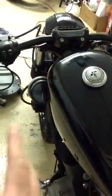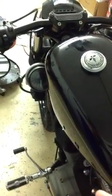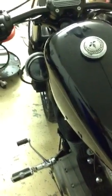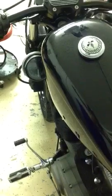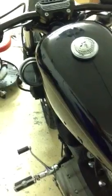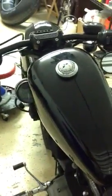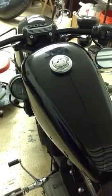Basically, what will happen as you turn your bike on is you'll see all the lights come up. During that time period, a diagnosis is going on, and typically when everything is okay the lights will turn off. In some cases the check engine light might stay on, which means you have a problem, or it'll turn off and then as you start the bike and turn the engine over it'll come back on for a few seconds, indicating that your diagnostic tool has detected a problem but most likely that the problem has self-corrected and gone away.